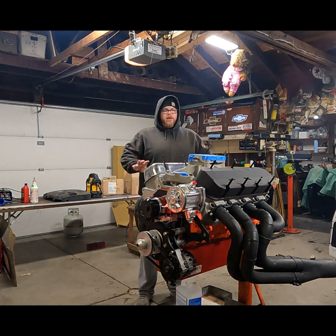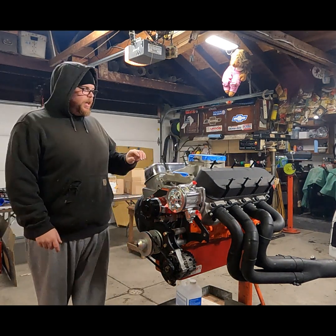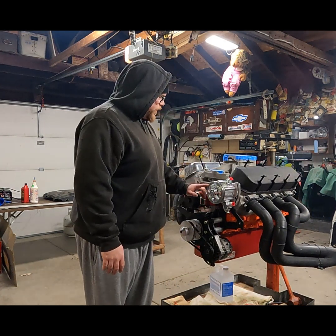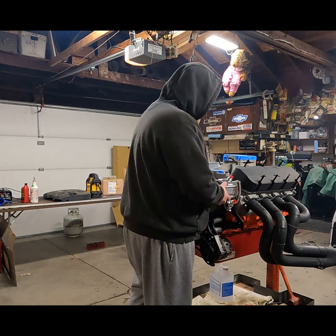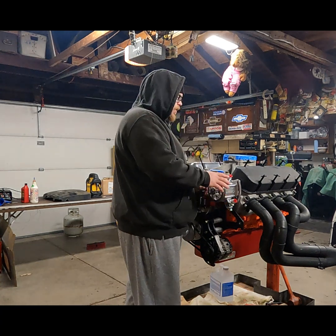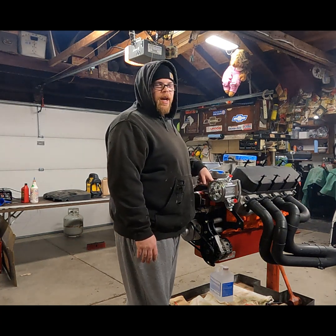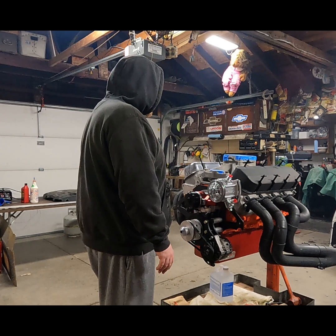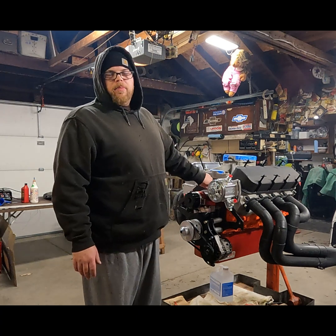If you had a car with a big motor plate on it, this would probably be a little bit easier — you'd just mount it right straight to the plate. Per Aerospace's instructions, they want it mounted on a flat surface. So far I've come up with mounting it on the cylinder head. The only bad thing is it looks like we've got to do a little clearance job to the valve cover, unless I make a spacer to go back behind it — which I think I might do. A nice big flat quarter-inch spacer to get it out in front of the motor plate.